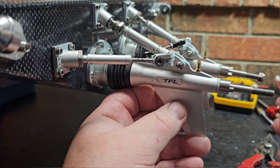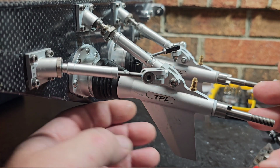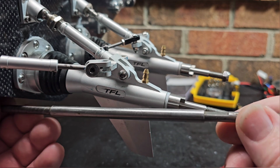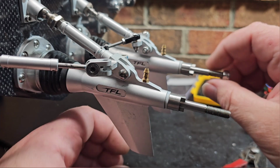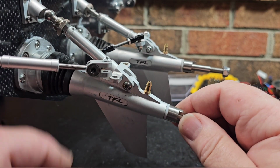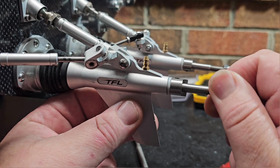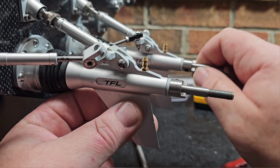I got this pushed all the way up. I spun these before I made my order, but there's a lot of resistance on them. Compared to a traditional flex cable in a stuffing tube and stinger, you could basically free spin it without any motor on it, no problem. With these, there's quite a bit of resistance. You've got the bushing, the universal style connection, then a bearing inside, then the stuffing tube and the flex cable. This one does not have a flex cable in it. This one does. You can see it's harder to spin with the same amount of force.